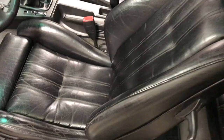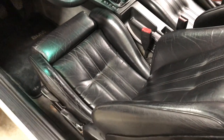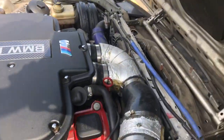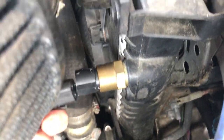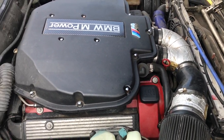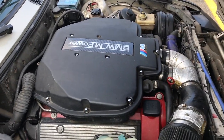I was on my way out to work today and I noticed that my temperature is actually being regulated quite well today, and I figured out why. Can you hear that? That's the sound of the fan going. Once I unplug the temperature switch, it turns off. Plug it back in, it turns on. So I guess it's working after all, but it appears to be intermittent, and that's never a good thing. So let's get that replaced anyway, just to make sure. It seems to be regulating temperature pretty well.